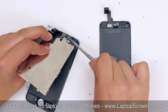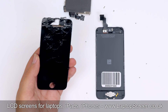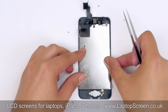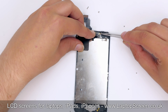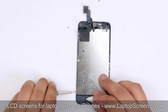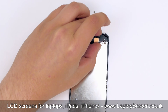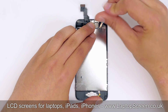Gently separate the metal shield with the attached webcam and discard the old front assembly. Place the metal shield onto the replacement part and align it with the mounting holes. Guide the webcam into its slot and use the guiding pegs at the top to make sure all elements are in the right position. Secure the metal shield with screws. Replace the earpiece, snap in the mounting bracket, and replace the two Phillips screws.